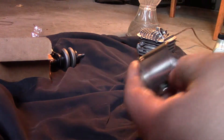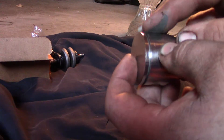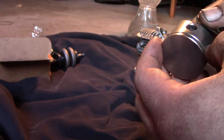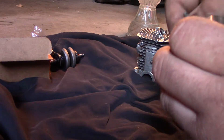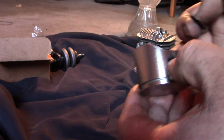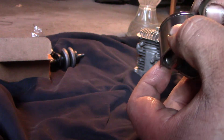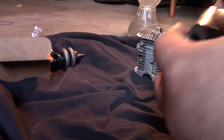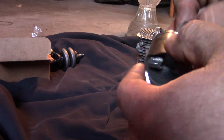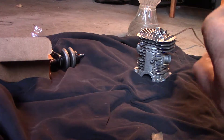That part's deburred and ready to go. Now this is your piston. Like I said, I've run into it — they don't seem to be deburring parts today. A little bit here, feels good. Put your finger around there, you just want to feel — it feels really good. Let me check up here where your ring land is for sharpness. If you've done this for a while, it's no problem. It feels pretty good. That tip there will save you a lot of aggravation in the long run.